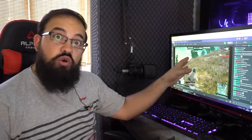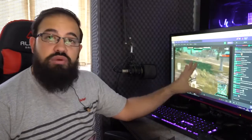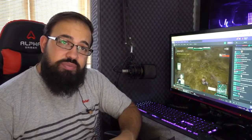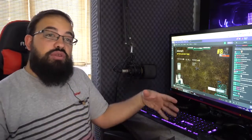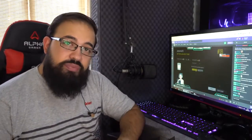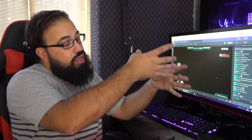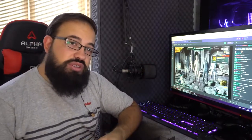It is a 24-inch monitor and uses 100x100 standard VESA mountings, which I am using right here — I'm not using the stand. A quick few points about the stand: it is height adjustable and the spring in it is quite strong, strong enough that you can't even push it easily by hand, so you need a large surface to be able to height adjust. It also has the clip we saw during the unboxing, which clips around the bottom of the stand at the back, where you can route your cables through and avoid a mess of cables all over the place.